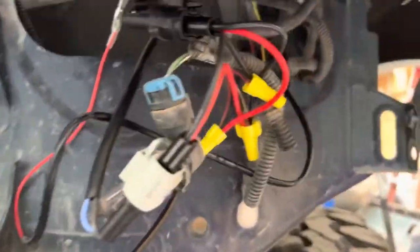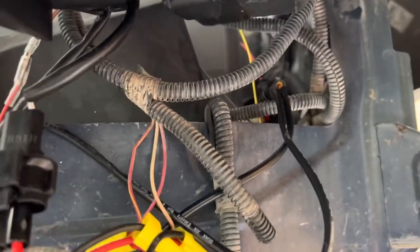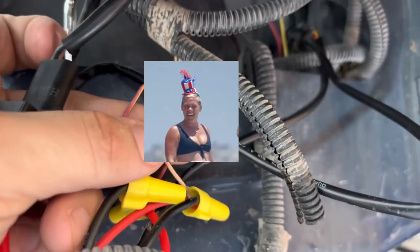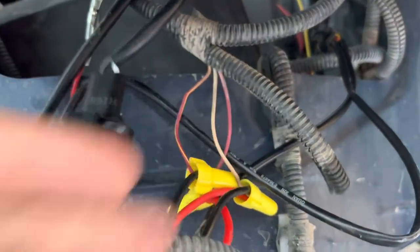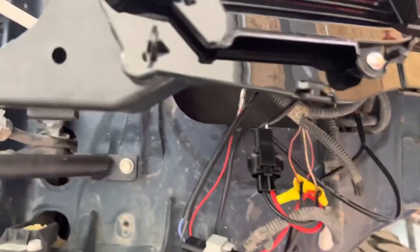It's a little different on the right headlight. The wiring harness here has yellow-on-red going to the low beam, and then what they call pink — it's kind of a red as well — but they refer to it as pink in the wiring diagram, and that's your high beam. Same thing, they both connect to the ground. Everything else is identical function-wise on the right side besides the colors.